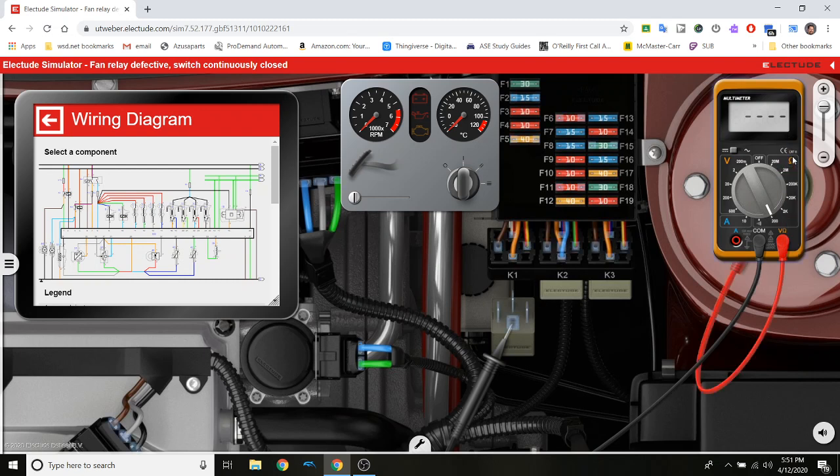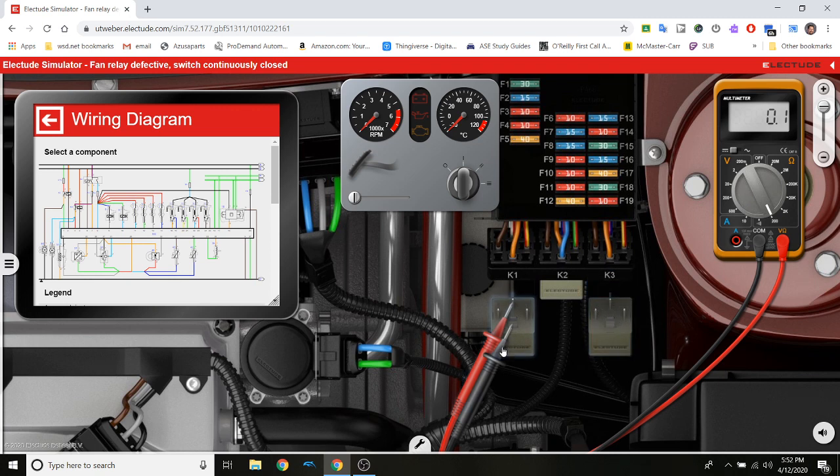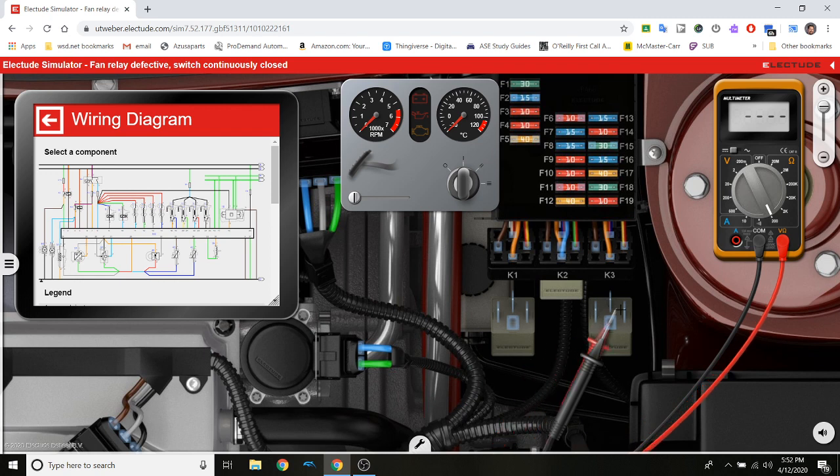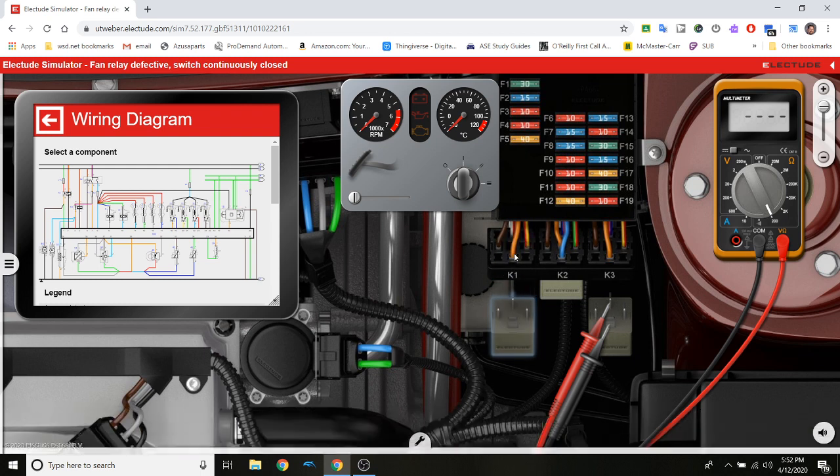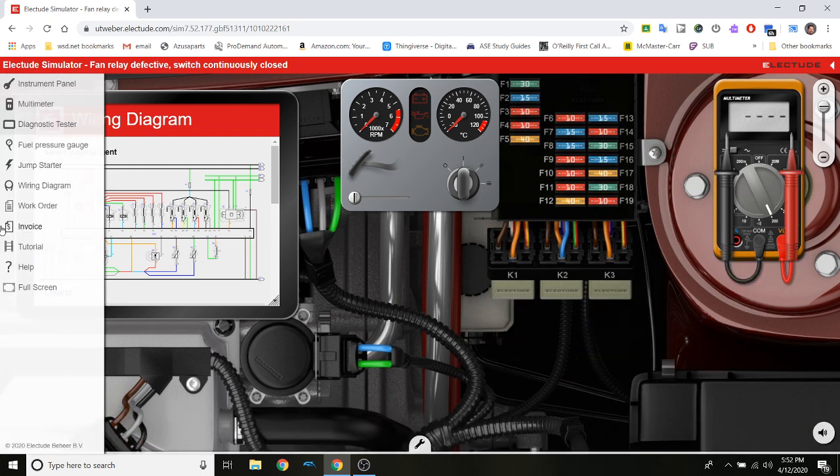Testing pins 2 to 3 — I'm getting a resistance reading, essentially zero. That tells me the gate is closed, meaning electricity is flowing. Closed means it's connected — current is flowing — and that tells me this relay is bad. K3 happens to be the same four-blade type, so I double-check: no reading on that one, confirming the difference. Since you can't swap relays to test on this simulator, I drop the bad relay in the parts bin, click on it to replace it, put the new one in, and plug it back into the car.